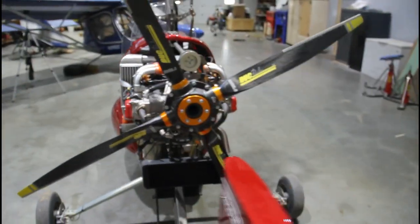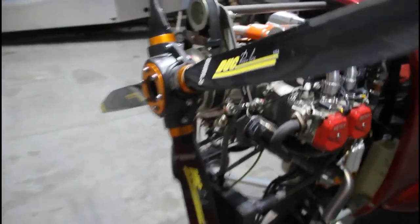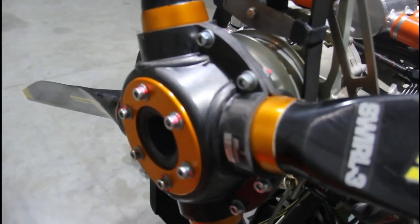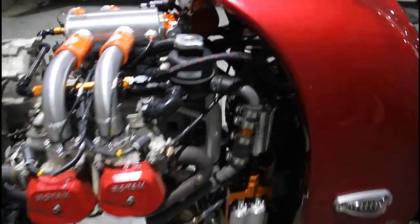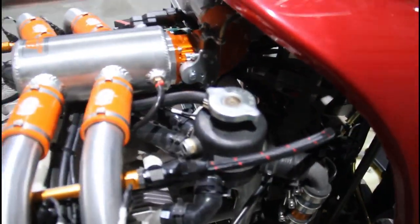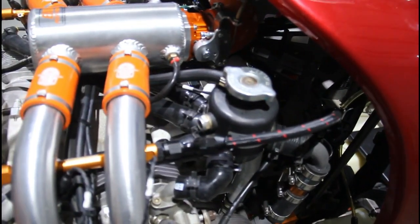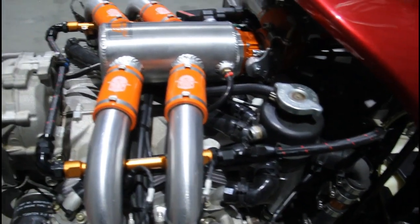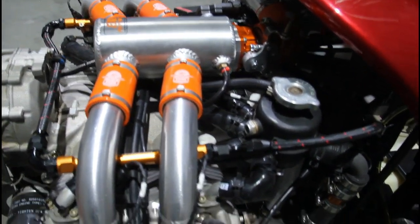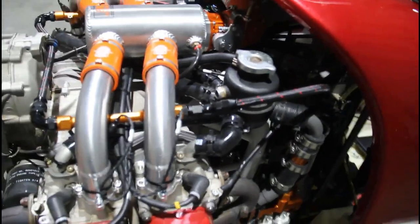It's got the Duke Swirl 3. It's kind of neat how they have some orange anodized that matches up with the Edge Performance stuff, so a little color coordinating going on. On the other side, the ignition modules move over, the coolant bottle moves over, and some new silicone hoses are included in the kit to allow moving that bottle over and running some new lines to it.